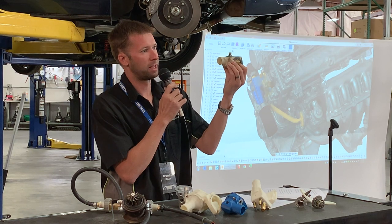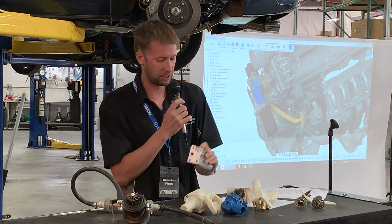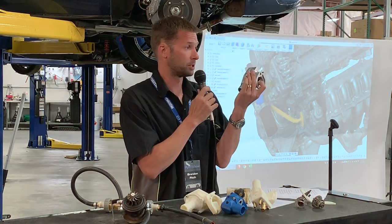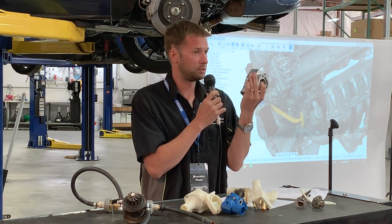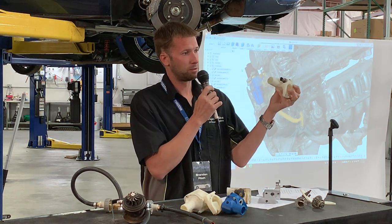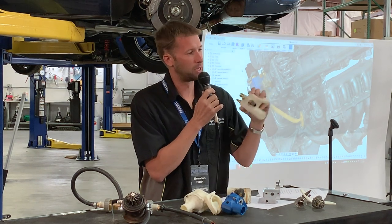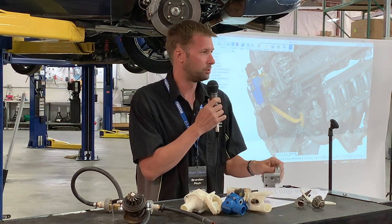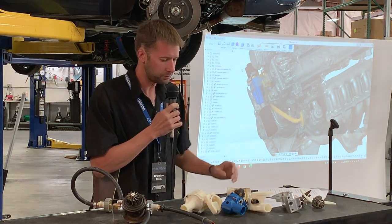With the thermostat down low, there's not enough clearance. Actually, the thermostat doesn't fit in here right now because that chamfer that's supposed to be in there isn't there, but it fits nicely in the final version. You can see the printed one has a real nice, smooth chamfer in there, and the thermostat is fine. But anyway, point being, making it so that the coolant gets to all the places it needs to, and that the specific type of coolant isn't pre or post thermostat, all that makes a difference.